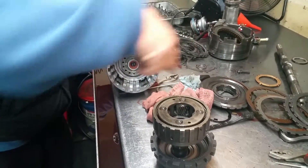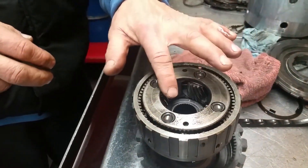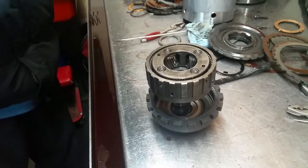This drives this. What happens is this planet — there's a thing that goes in there — all these gears break and weld together. So this is solid instead of spinning. Basically a locked differential; correct, in layman's terms, yes.